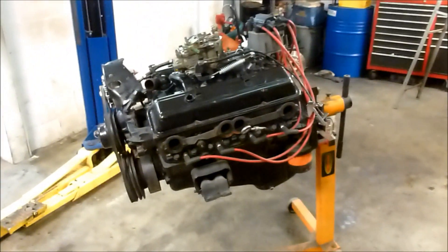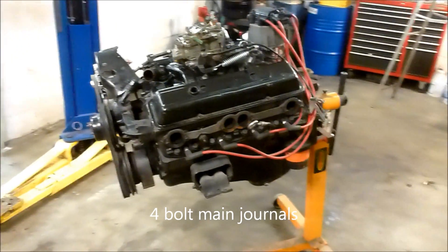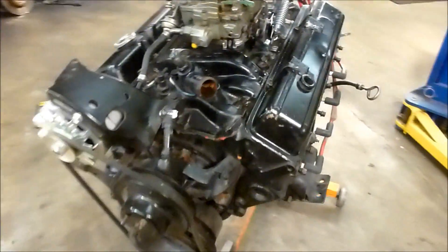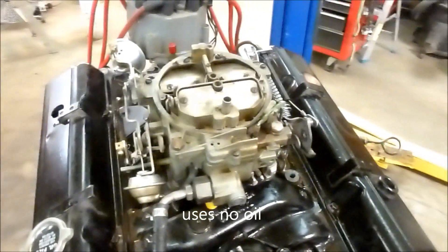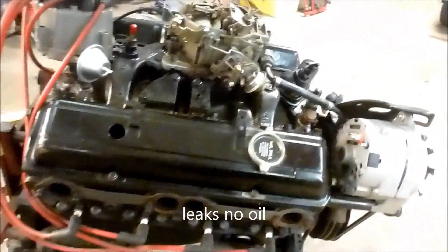So I now have the V8 hanging on my engine stand. It's a good running small block Chevy 350 crate engine. It has a four barrel Quadrajet carburetor that I've rebuilt at 750 CFM — it works great. The engine has less than a thousand miles on it, it might have more like 500.